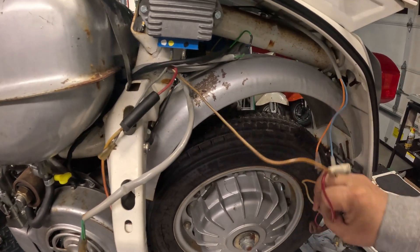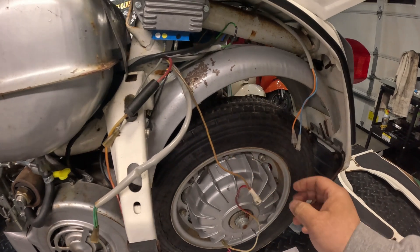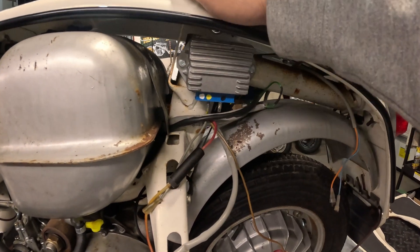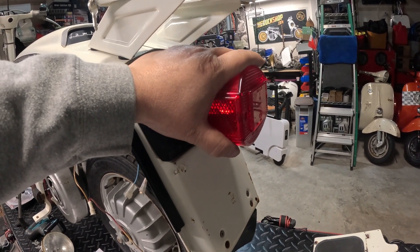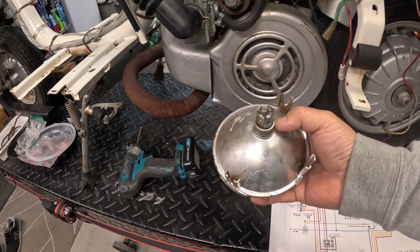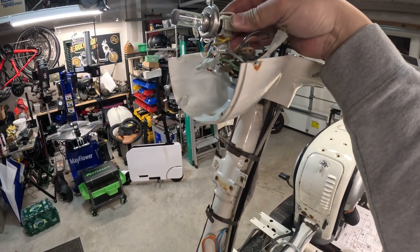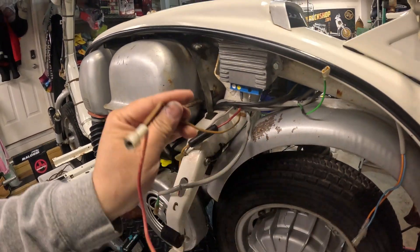After that, really all that's left is this one wire right here. It might seem like a lot of wiring but it's just one wire — it used to go to multiple points on the regulator and also the key. All you need to do is cut this off, put a spade terminal on it, and plug into the white port of the regulator and then you'll have power to the bike. The other thing you need to do before you start the bike is change the bulbs to 12 volts. On the headlight it's a sealed beam 6 volt, so I can't just simply change the bulb — I have another one on the way. In the meantime for testing purposes, I've installed an H4 automotive headlight bulb, 12 volts.